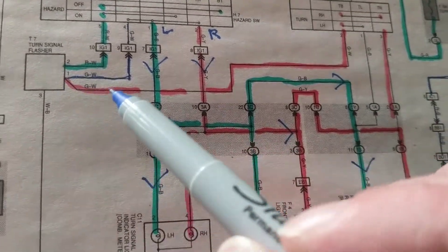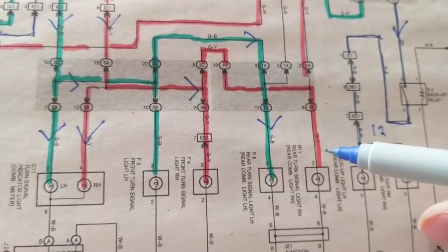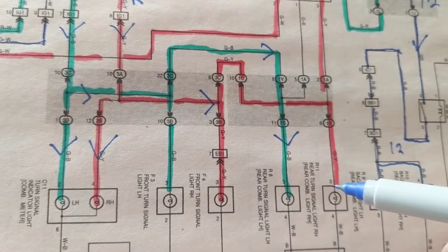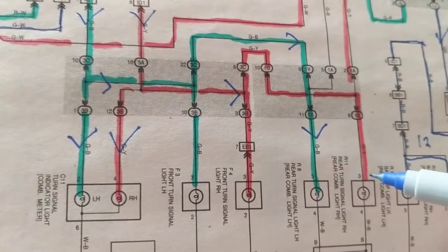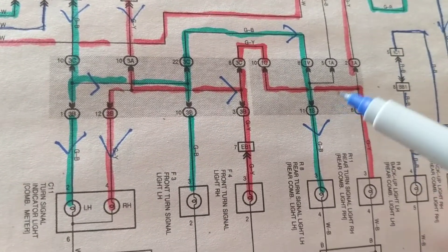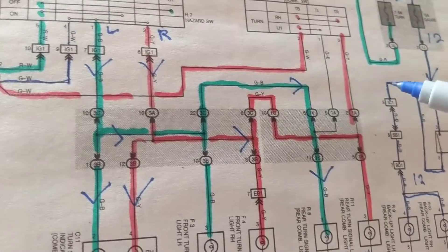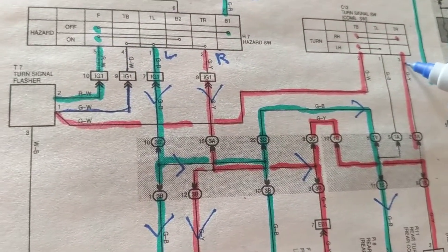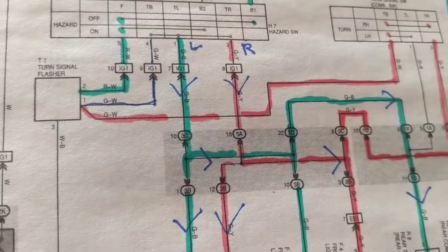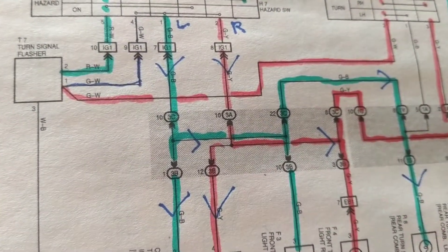For the signal light: I put on the left signal light and I don't see it going on. I ask myself: is it in the front or the rear? Sometimes you have that indicator clicking very quickly, so you know one light is out — you hear that rapid clicking and you know one light is out, usually in the rear. Why does it still click? Because the flasher is working, but the light is not illuminating.